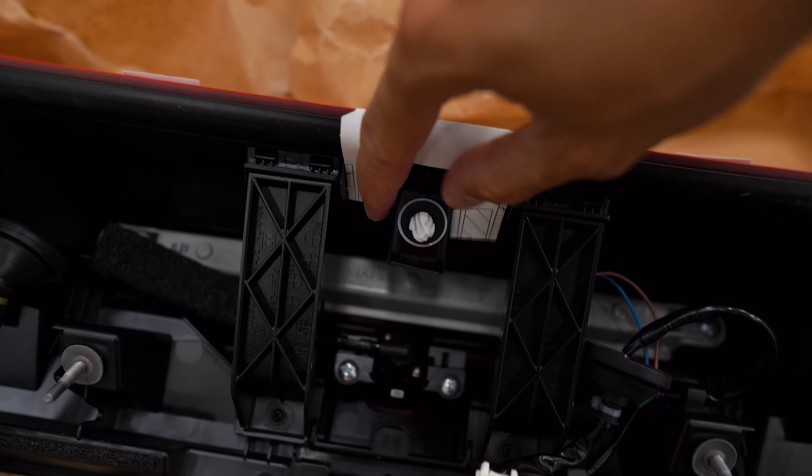I'm curious what you guys think — I think it looks a whole lot better. It certainly beats paying for a premium trim if you just like the look of the duckbill; obviously the premium also gets nicer headlights, seats, and wheels. This was the main thing I wanted on the premium trim that the base model didn't have. A lot of people are worried about drilling into their trunk — you can actually do this without any drilling at all by just taking the studs off the underside of the duckbill and using the pre-applied 3M to install it onto the trunk. I wanted it to be more secure so I went the drilling route — completely up to you.